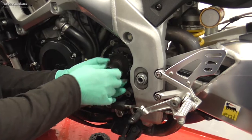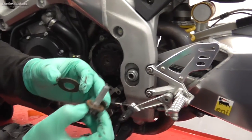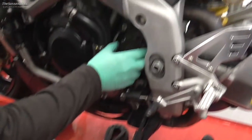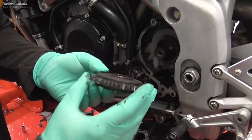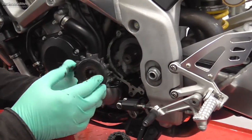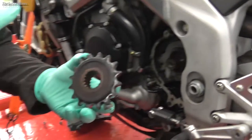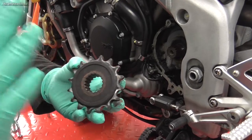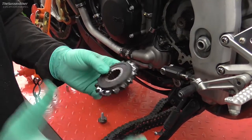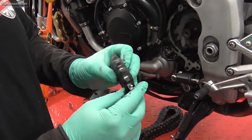I'm going to fully remove the front sprocket. As you can see on this bike you've got a washer with a little domed bit and then just a flat washer — that's how that fits. You'll note that the shoulder goes on the inside. This sprocket is a 16 tooth. We are actually going to be upgrading and fitting a 15 tooth to this bike — apparently Jeff's looked on the forums and they reckon it makes it more rideable, so it'll be interesting to see. I might even do a video on that later on once it's all back together.